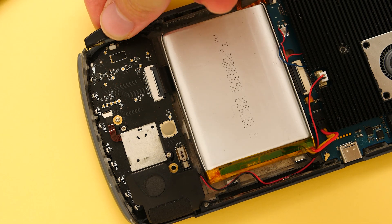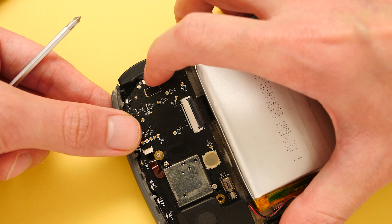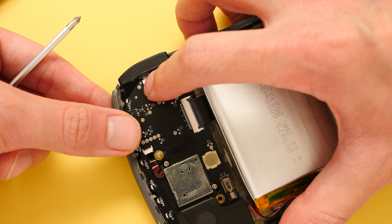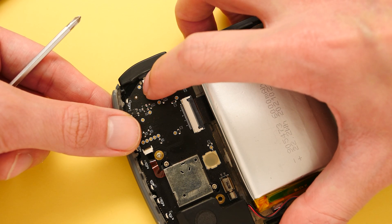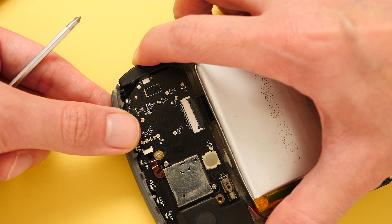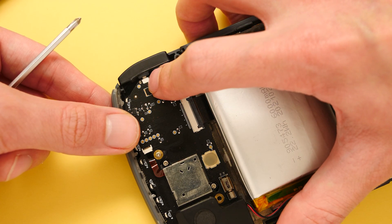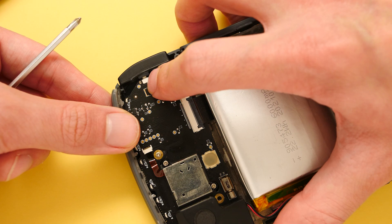Let's talk about where the issue arises. When you press down on this button, the rubber piece on the inside applies some pressure on the top of the Switch and it makes a clicking noise. The problem is there's nothing stopping you from continuing to apply pressure to this button. I think some people had this Switch broken from the factory because it wasn't tested correctly, but others can probably break this from excessive force.